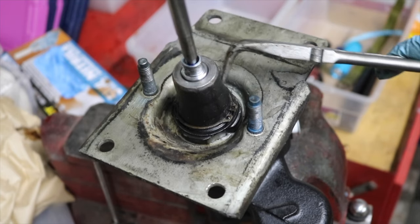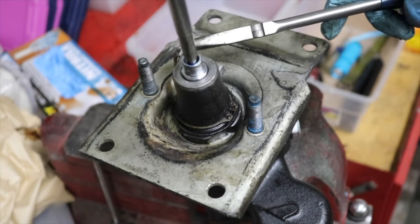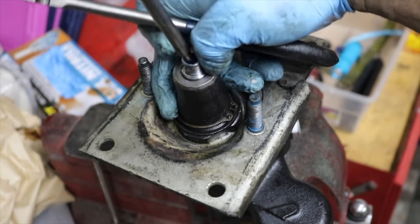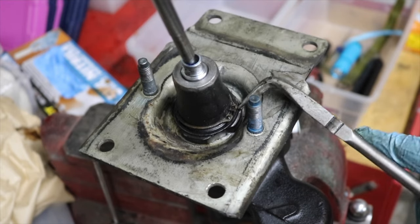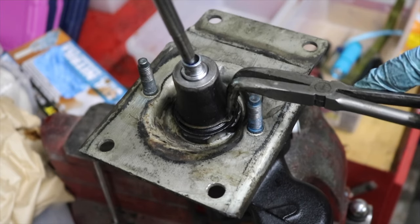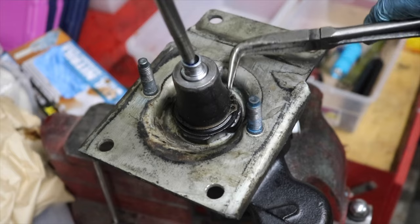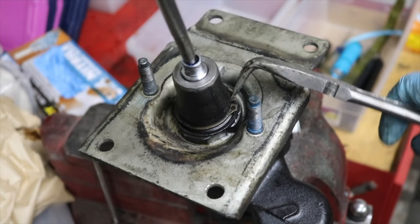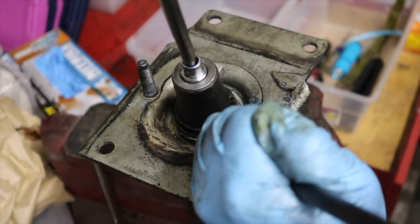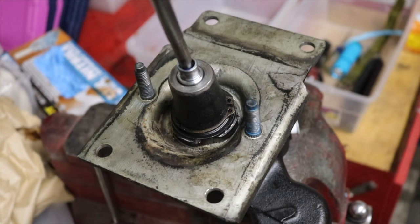Always check the back side of your C-clips too, especially if it's somewhere you can't see very well — just get around there and check the back side of it to make sure. You can feel if it's all dialed in there. These should have a little bit of a split on them, but not much. It could be half up on part of it and not doing its job of keeping this from coming up. It doesn't move. Cotter key's locked in.